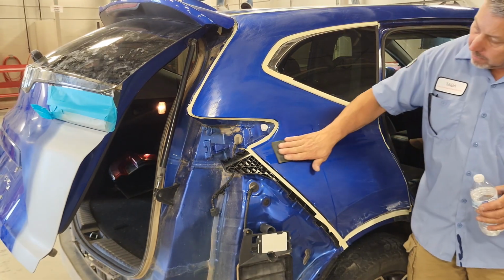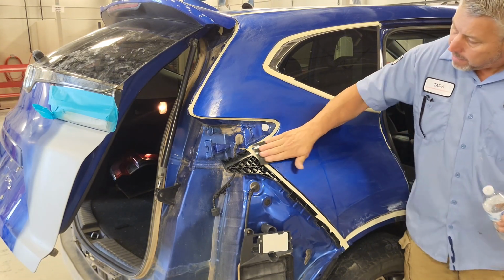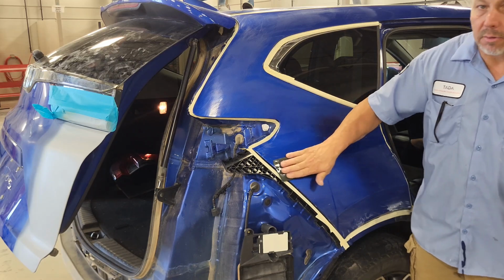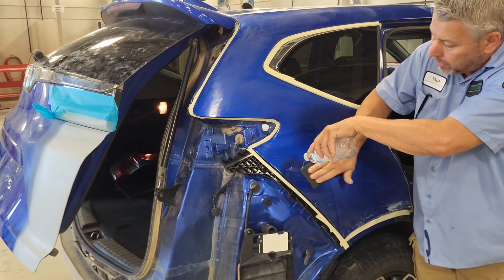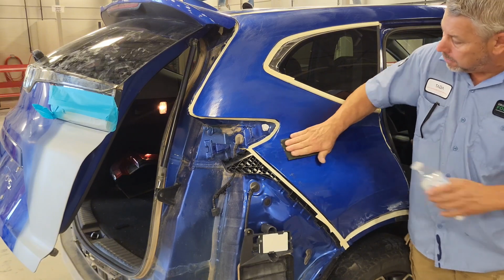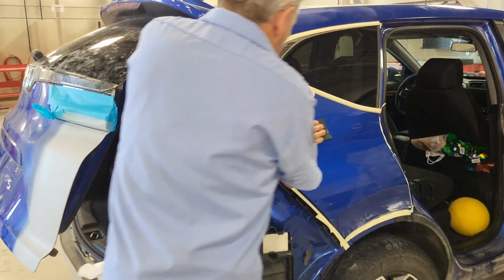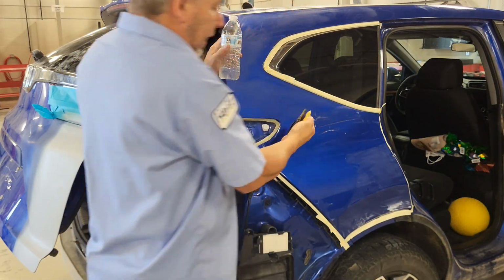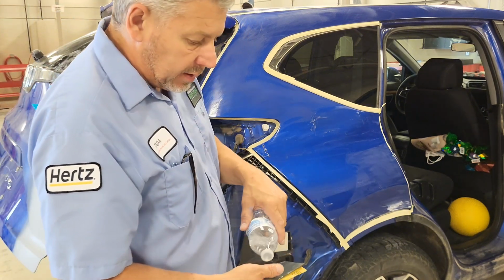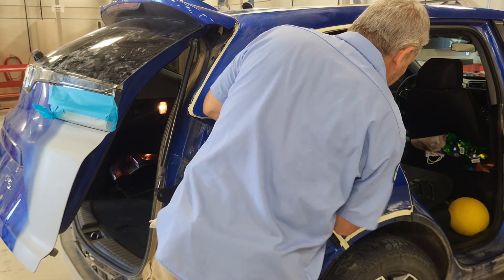I've already hit it a little bit, but notice how I'm going with what's called go with the grain. Anytime I'm prepping anything for ultrafine, if I'm using any kind of ultrafine sandpapers, always go with the grain. Notice I'm going to keep my sand scratches going all the same direction. So as I prep this out, and this is old school techniques. Most of the guys are using DAs now, but no bigger than this area is, I'm just going to go with my old school by hand.